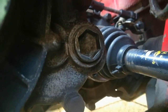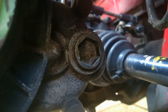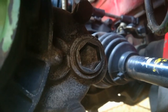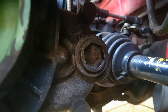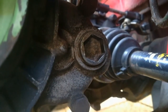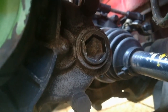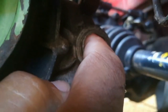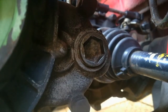As you can see, it's a 17mm Allen key type tool that you would need. But many people become very creative and make their own tools, like using the back of a 17mm bolt. So the idea is, once you've removed this nut and oil runs out, you will know that your level is correct. If nothing runs out, then you know that you need to top up. So when you top up, you insert a little pipe in here and pour in some more oil.